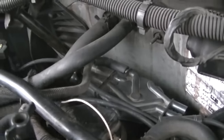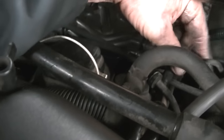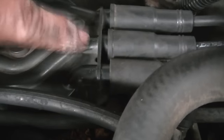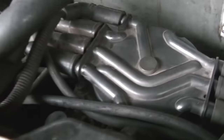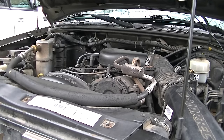The rotor cap is bolted back on - make sure you don't strip those bolts. I've got my coil wire back on and now I'll hook up the three plug wires on this side. On this distributor cap there are numbers for the firing order and I can verify all three are in the right place just like how I took them off. If you look closely there are numbers on the cap - that's your firing order number. You've got to follow the little indentation: number one is actually over here - so it's very confusing sometimes. You can see the numbers: three, one, five on one side and two, four, and six on the other. All that's back together so let's see if it'll start up.